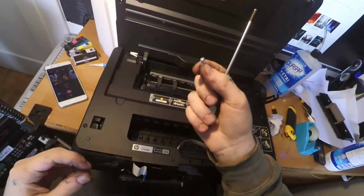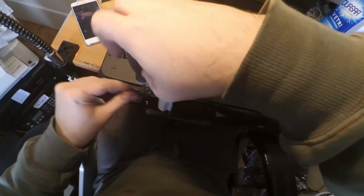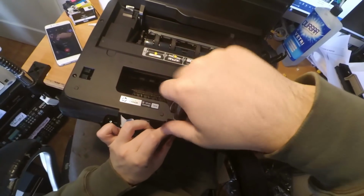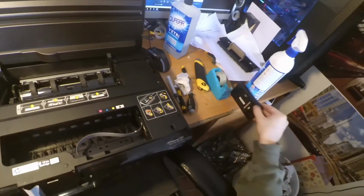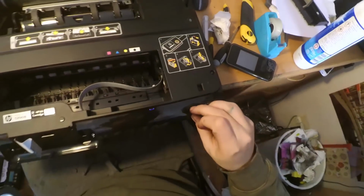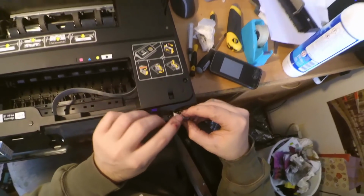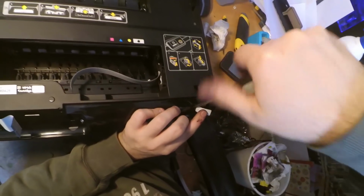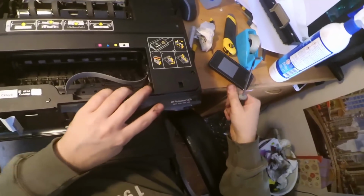Use the white screws for the LCD part, so that they will be hidden, because, you know, the LCD will be on top, and use the black screws for the visible parts. This is just for aesthetics, so it's not a necessary thing. And now the last screw is behind the sticker, as always. So I will take it inside here and screw it back in place. Now take the sticker here again.